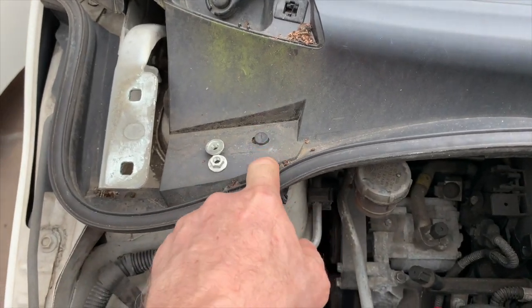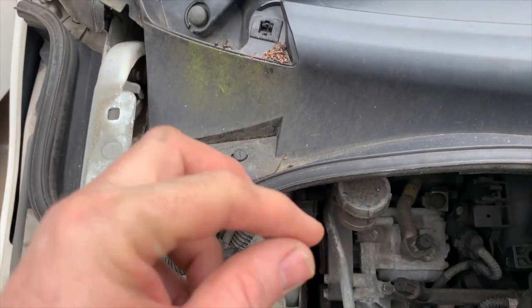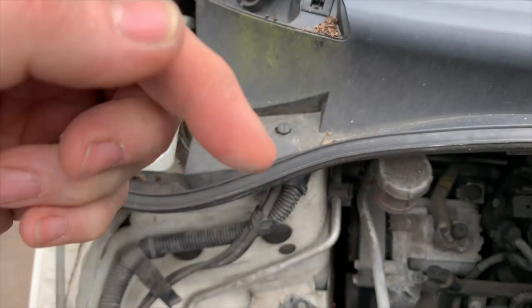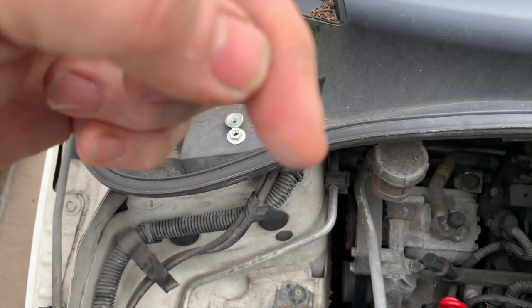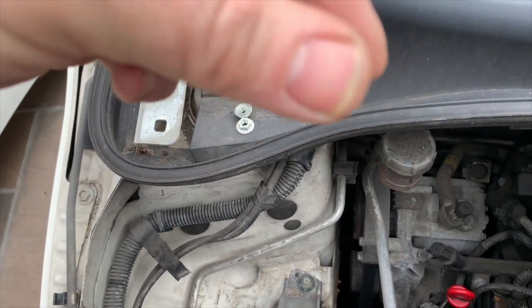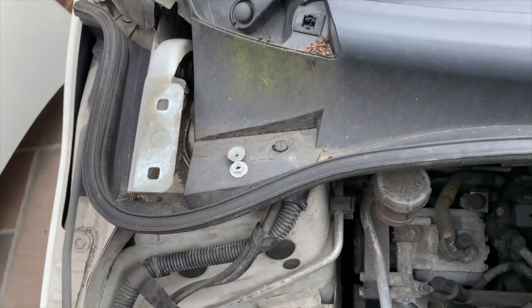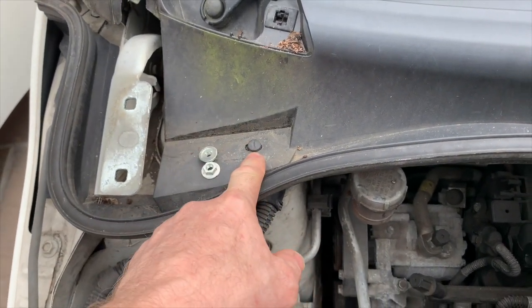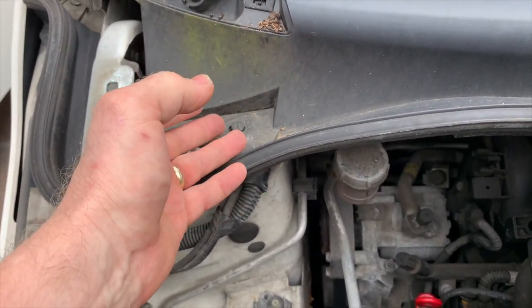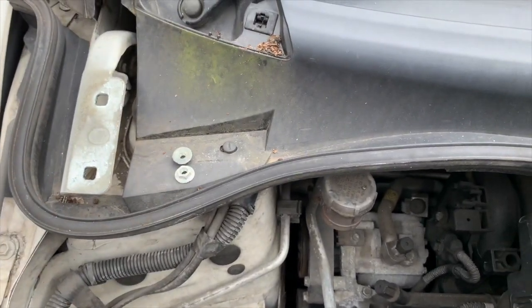What I do is I buy 4mm pins - they're like plastic push pins. You push it in and as you push it in, you turn the screw on the top and the ends of it splay out which then hold it into position. So we'll get those out now - just a screwdriver, try and turn them to get them out, and if they don't come out by turning then you just prise them out.